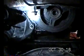Okay, I spent a big chunk of today working on this bracket here, trying to get this thing loose. It wasn't easy, and I still never got it off. The 15 millimeter bolt is still up there, pressed against this frame. But at least I got it to slide around. I used all kinds of stuff. I lowered the engine cradle and raised it and lowered it and raised it. I had to fool around with it. It wasn't easy. There's a 15 millimeter bolt up there.